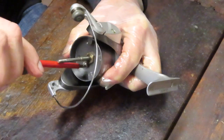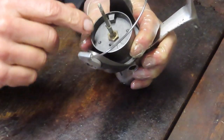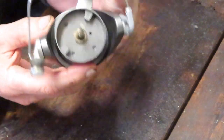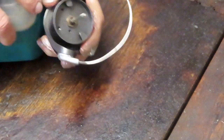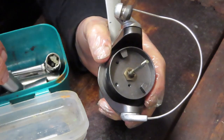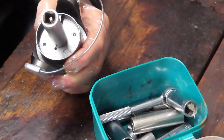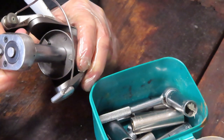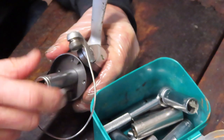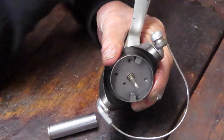Once you do that, come in and remove the little set screw, then remove the rotor nut. This one has a lip so it's hard to get a wrench on it. Move the axle shaft all the way to the bottom and use a deep 12mm socket. This is a reverse thread, so to remove it you're turning it in a clockwise manner — the opposite of what you'd normally do. Once the rotor nut is off, put that into the tray.